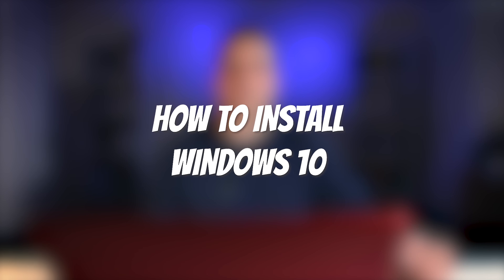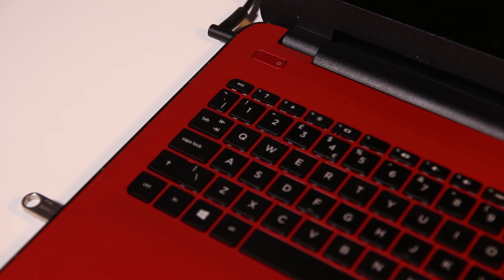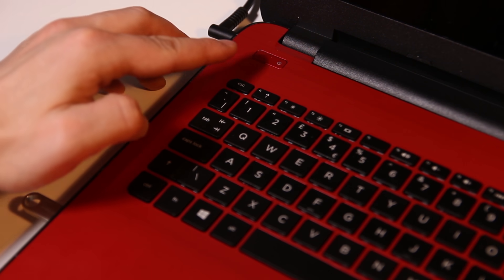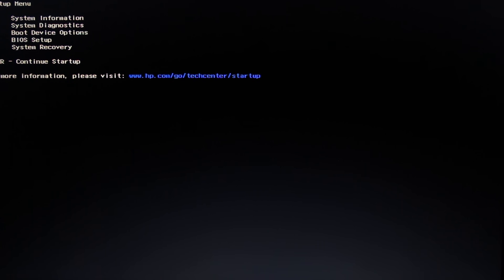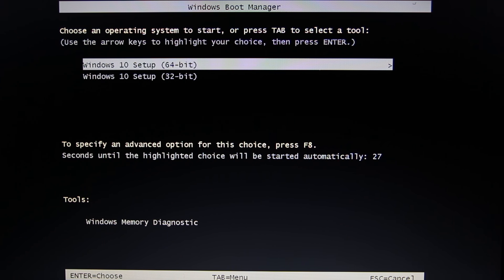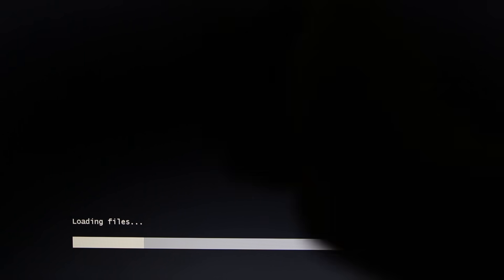Finally, I can plug in the charger and we're ready to install Windows 10. With the new SSD installed, we just need to install Windows 10 using the Windows 10 installation USB. Every computer has a different way of booting up from a USB drive. On this laptop, I need to press the Escape key repeatedly after turning it on. Then the Startup menu appears, and I can see that to choose the boot device I should press F9. Then I use the arrow keys to select my USB drive and press Enter. I have a choice of 32-bit or 64-bit — on most modern computers you should choose 64-bit, and if you get an error message, start again and choose 32-bit instead.